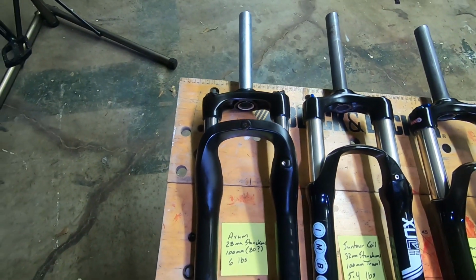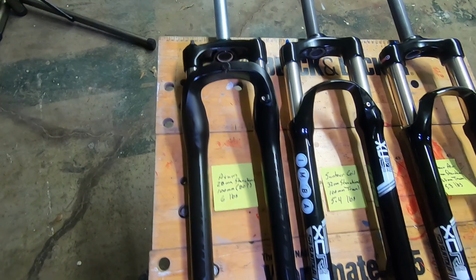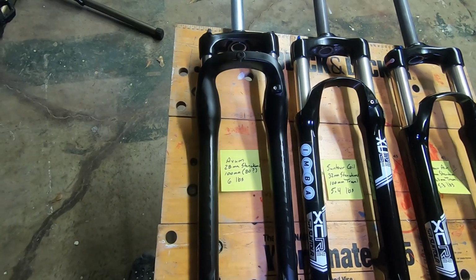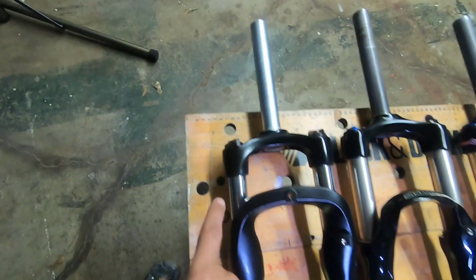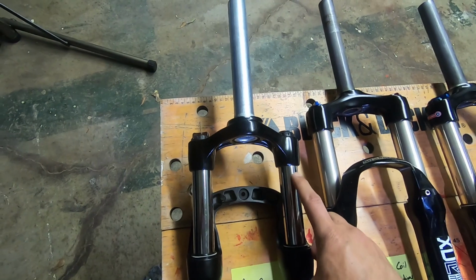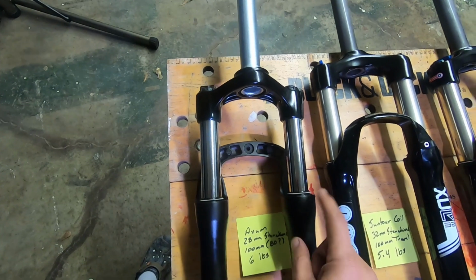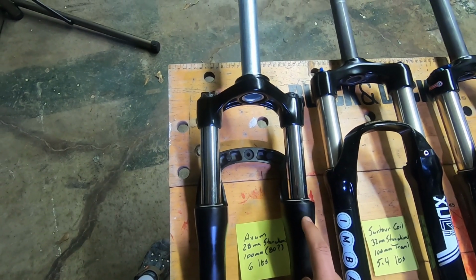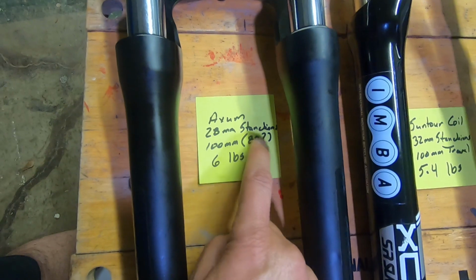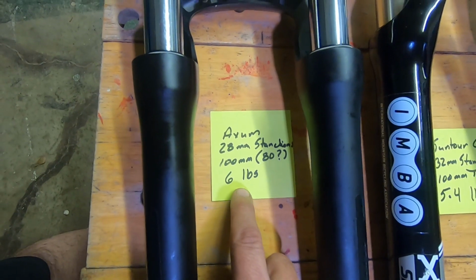So it was very similar to a suspension fork that I very recently put on my channel and took apart, which is the Schwinn fork that comes on the Schwinn Axum. The stanchions here, when I measured them on the Schwinn, this distance from here to here, it's 100mm, but you can't really get 100mm the full travel. So this might be an actual 80mm travel fork of actual travel. So I put here that has 28mm stanchions, maybe 100mm travel versus I think it's more of an 80mm, and it weighs an even 6 pounds.